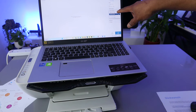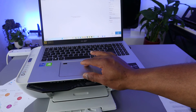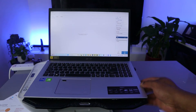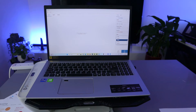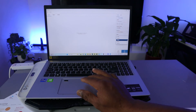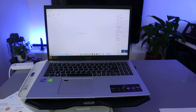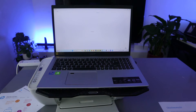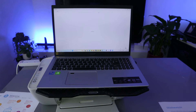The scan area is A4. If you want to scan the entire area you can, or select a specific size like 4x6 or 5x7 — we want A4. For output, we want to scan in color. Scroll down and select the resolution — the maximum resolution is 1200 DPI when using your computer; we'll leave it at 300 DPI. Then you can select scan, or select preview to see what the document will look like before scanning.